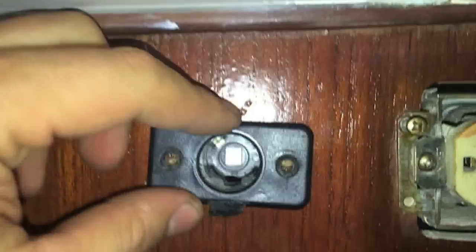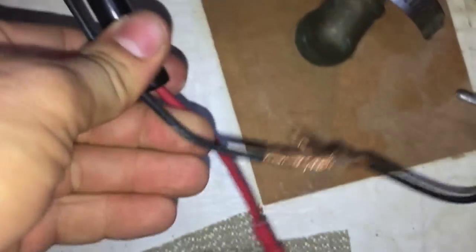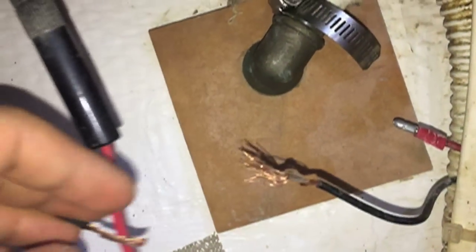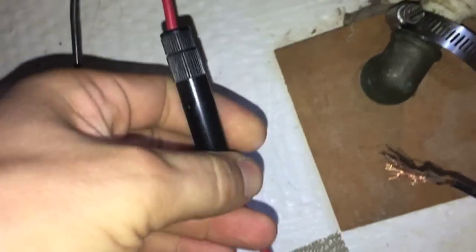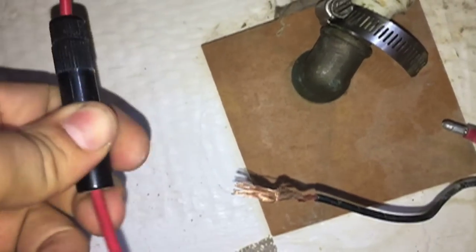I see that he had a DC socket over here — I'm going to remove that. All that was, was just pigtailed and wrapped in some electrical tape, practically falling off. He did have the forethought to put in a fuse, but it was a 30-amp fuse, and when I look inside and wrestle it away, it's not 10-gauge wire. Every turn I take, it's amateur hour.